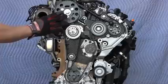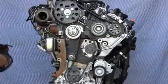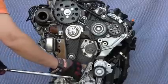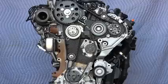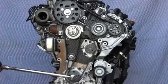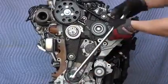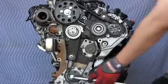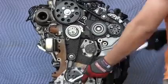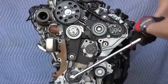If you've done everything right, the timing belt is in its final position, but you still have to check. Remove the camshaft pin, the fuel pump sprocket pin, and the crankshaft lock. If the crankshaft lock has gotten a little tight, just wiggle the crankshaft sprocket around until it slides out. To verify everything is okay, turn the engine over twice manually. As you're turning the engine over, you should feel normal compression building and releasing. If you feel anything jamming — which you shouldn't if you did everything right — then immediately stop.